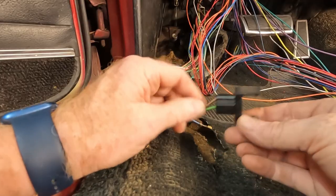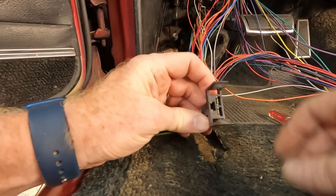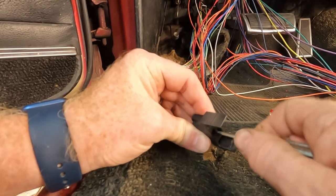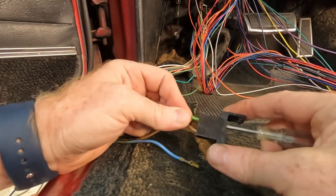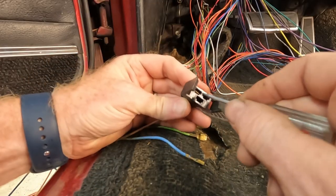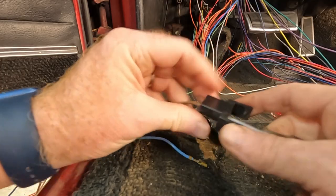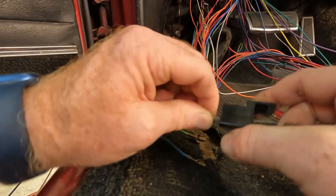Painless doesn't have a clip like this on my dimmer switch. Just in case you don't know, in order to get your wires out — the old ones — you just get a really thin screwdriver, slide it in here to the bottom until you sort of feel it grab, and then that's going to loosen the wire so it comes out. You put it not on the top part where there's more room, but on that little bottom area where there's not as much room. You're just bending back up the clip, and then that lets you take out the old wire.